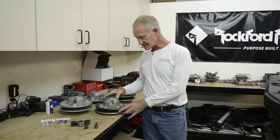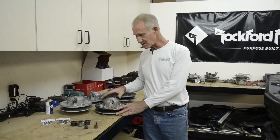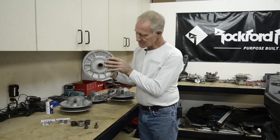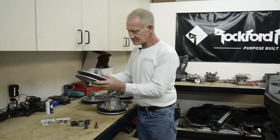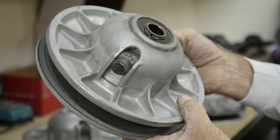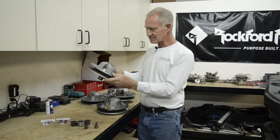There are a couple of different styles of secondary clutch. We call this a BOSS style secondary — BOSS means Built On Shaft Secondary — so the shaft goes through and holds the clutch together. The other style is a little more common and comes out in some of the 900s and of course the 1000s. It has a shaft in it, so this one's built on the shaft and this one has the shaft as part of the clutch.